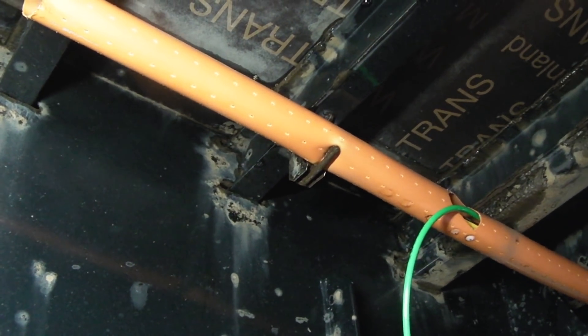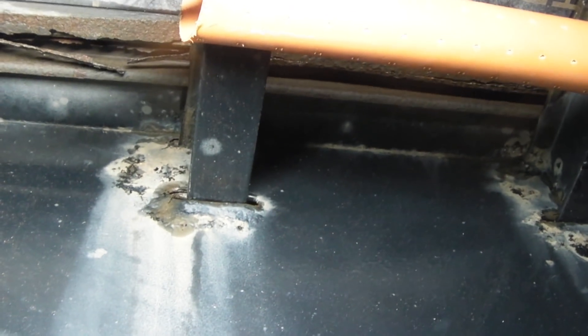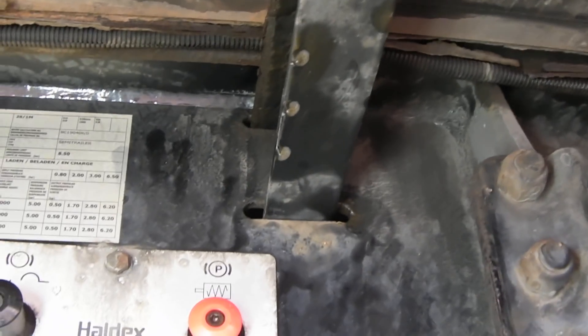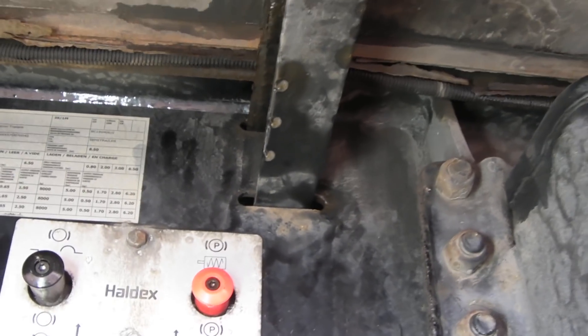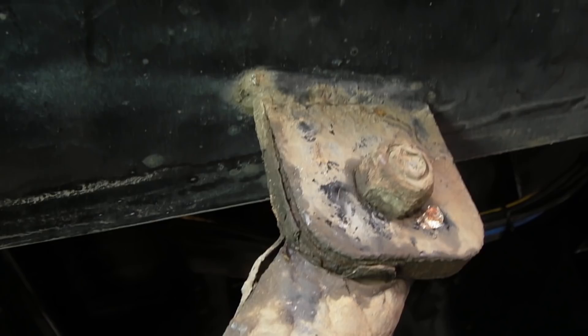The paint has been cracked through the compression of the outriggers. These are load-bearing outriggers where the floor sits on, and I think every single one of these on the trailer has got corrosion on it. I think the paint has been compressed and then cracked, and the corrosion has been allowed to go through. The same here between these two surfaces — they've been compressed and the paint has cracked. Just a thought.